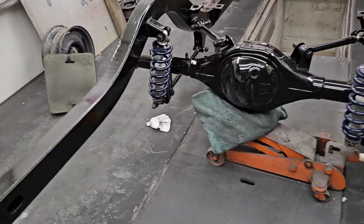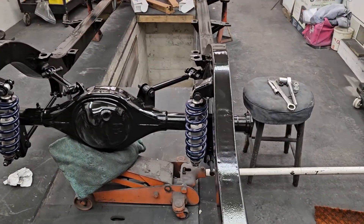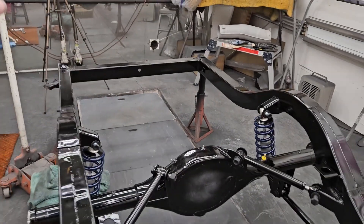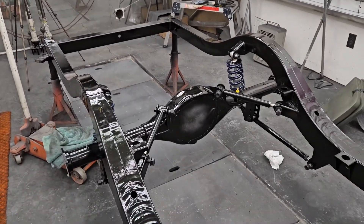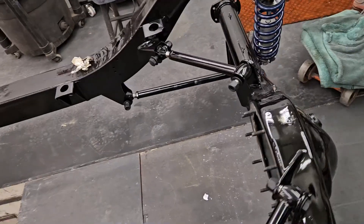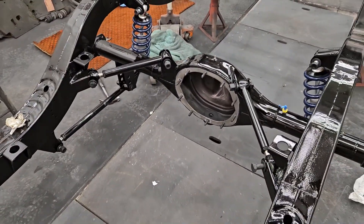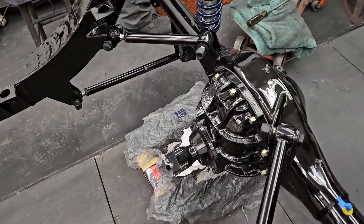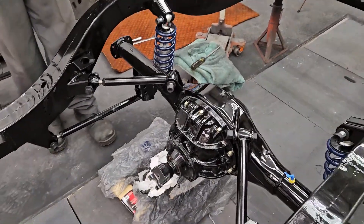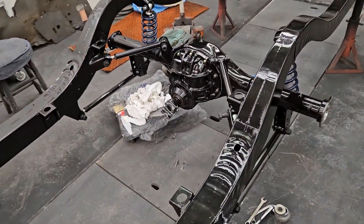One of the things we found is the bolt has to go from the other direction. Let's get this one bolted on. Obviously none of this stuff has been torqued and won't be for a while — we just need it all in place. We just got those studs in, that was fun. Turned out the nut off a rod bolt really did a good job for that, so studs are installed. You always forget how heavy these are. Getting ready to drive all that down — we don't even bother with the gasket, that always leaks, so we just RTV them. Torqued down, cleaned up the excess goop — that looks really nice.